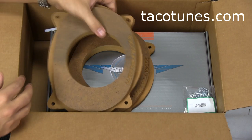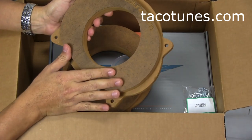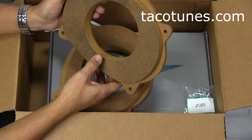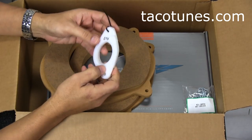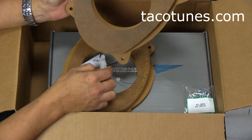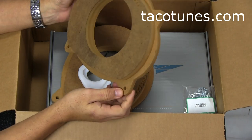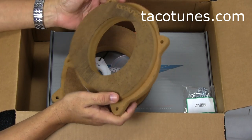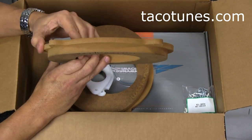First thing you're going to notice is the speaker mounts. These are made specifically for your Toyota, and we cut this mounting diameter specifically for the CTX 65CS. We also include the tweeter mount that you're going to need, which works in your Toyota as well. And with these two parts, there's no special cutting or drilling or anything. Our standard out-of-the-box product includes this outdoor-grade MDF — it's actually pretty nice. It's made with zinc borate, an outdoor-grade material, not just your regular store-bought MDF.